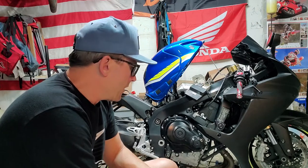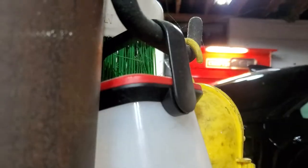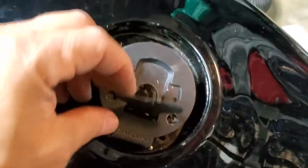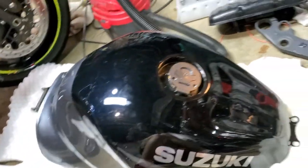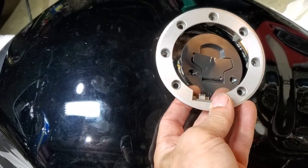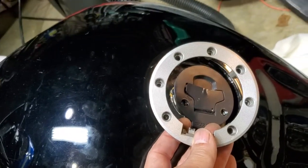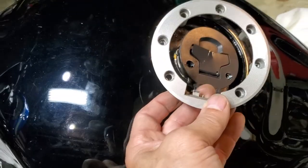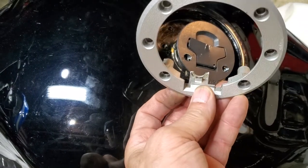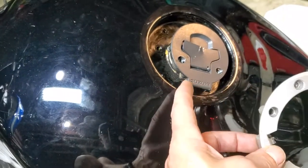Here's what we do to get the cap off. I even tried drilling — I tried all kinds of stuff to get it off, even drilled inside it to get the lock out. It didn't matter. So here's what you do. This ring that's attached to the hinge part right here — it helps if you can get this ring out first. Remove all the screws and fasteners, and then there'll be a couple of little pins right here on the hinge. You may have to use a little pick or something to get these pins out of the hinge.